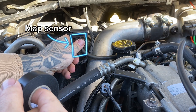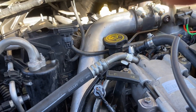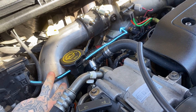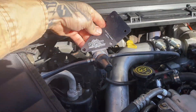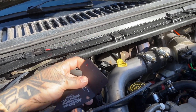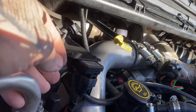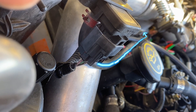Okay, right here, just gonna unplug it and then it runs over here. Unplug this little nipple on the spider, or unplug this from the fitting nipple. And then we're just gonna run this hose right there, and we're gonna mount this piece in place, and then we're gonna remount this MAP sensor assembly harness on these two, and then run this in right here where my middle finger's at. It's real simple.